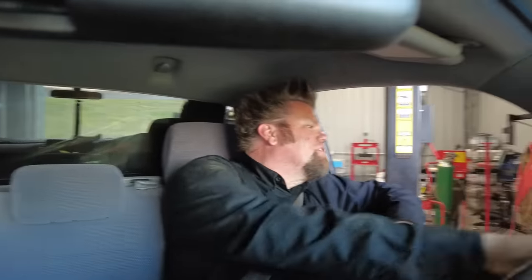I think I still have some air in the clutch master. Bled it the best I could, bleeding it by myself, but a little tricky to shift, and the clutch is pretty close to the floor, so I think that's what it is, but we'll worry about that later. Right now, we're going for a drive.